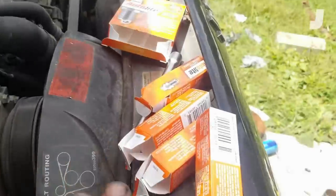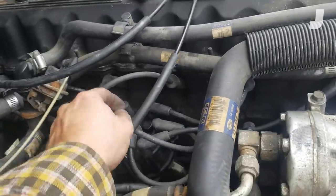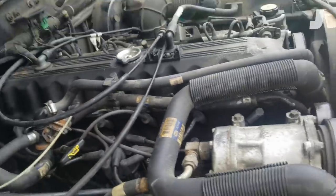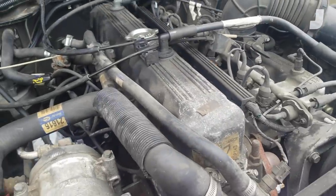We've got a battery and some new spark plugs in. The old spark plugs we broke when we took them out to fill the cylinders with some light oil. We've shot that light oil out and now it's just a matter of seeing if this thing runs. We haven't fired up this Jeep in two-plus years, so let's see what happens.